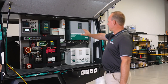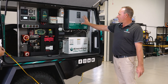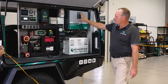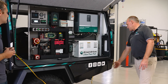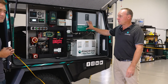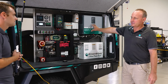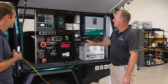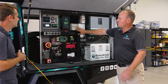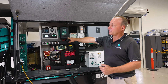Basically what we've got here are two setups. We've got a caravan setup with our Pro Series - a 3000 watt inverter, 120 amp hour battery charger. We've got a transfer switch with a plug on the back of the ute so you can plug into 240 volt to charge the battery up quickly. This inverter will run the induction and coffee machine at the same time. We've also run a separate TriStar solar controller, so while you're driving you're getting input from your solar panels on your roof.